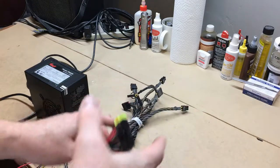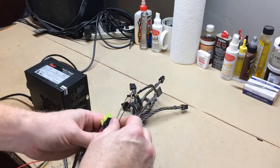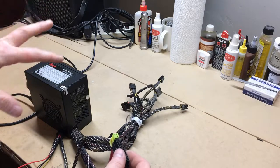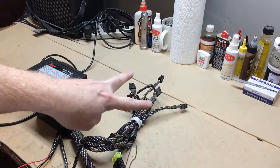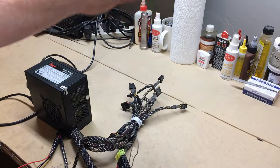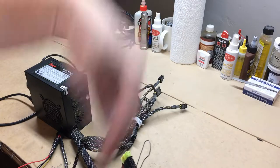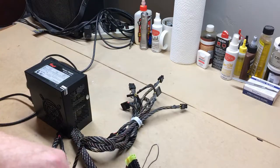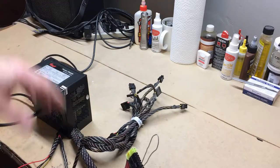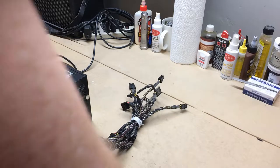I need to pause to pull everything else out and get set up to do the bench test for the radio. I'm going to be testing several things: the radio, the speakers, the backup camera. I've got two switches — one for the switched power to emulate ignition, and another to emulate putting the vehicle into reverse, which tells the backup camera to come on. We're going to plug in my iPod, maybe even Bluetooth my phone, and make sure everything works.